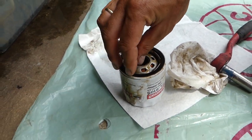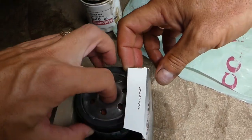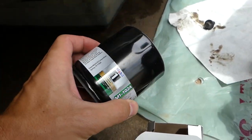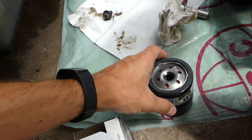You always have to make sure that the seal is still on the old filter, because sometimes it will be stuck on the oil filter housing, and you don't want to install another filter over the old seal. This is the new one — we're going with Mobil 1 Annual Protection Extended Performance. It's a little bit expensive, but we like using that.